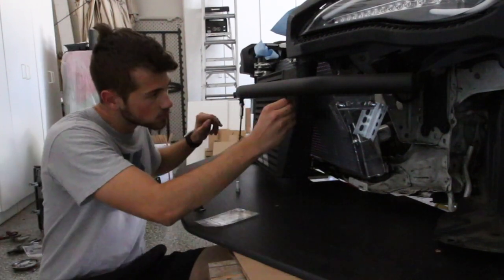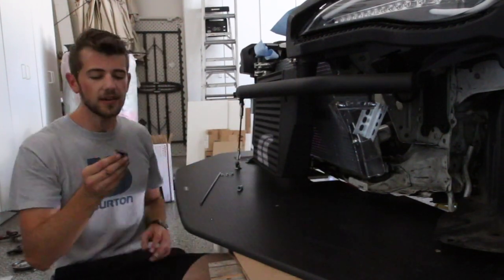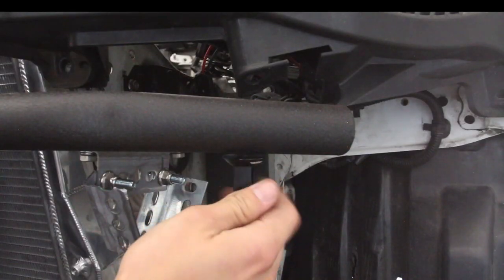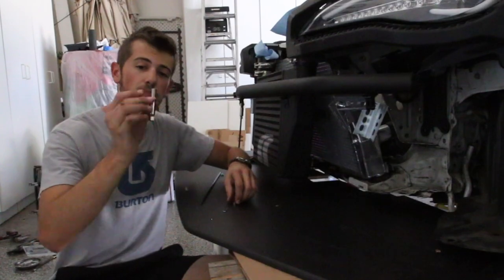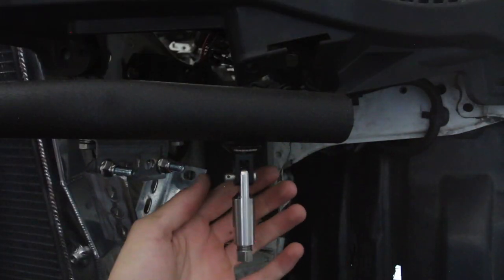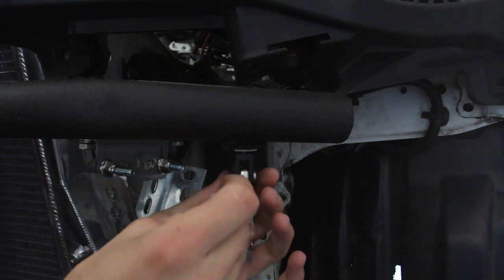To resolve the thread size mismatch, I bought a converter stud that has an M6 by 1.0 part on one end and an M8 by 1.25 part on the other. I start by installing these into the bumper bar. Once the converter stud is in, I go ahead and install the clevices, then take the part that connects to the splitter rod, slide it into the hole, put the pin in, and then put the clip in.